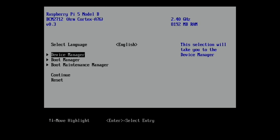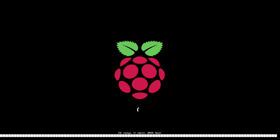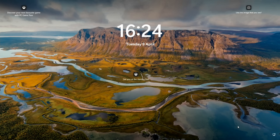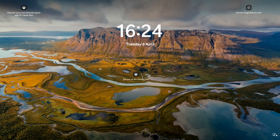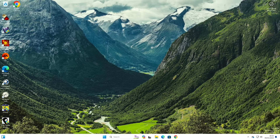It's booting up again and it does boot up really fast now. I've got Ethernet connected. If you're booting and you've got a USB Ethernet adapter and it shows up as a globe symbol, that generally means it hasn't loaded the USB correctly. What I tend to find is if you unplug the USB Ethernet adapter and plug it back in, or unplug the Ethernet cable, you should get it to work. Let's just log in — super super fast.